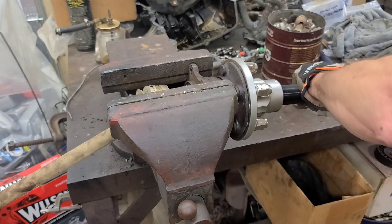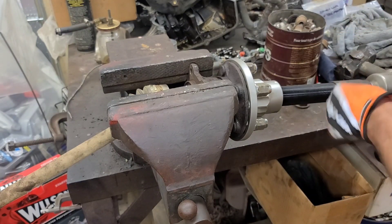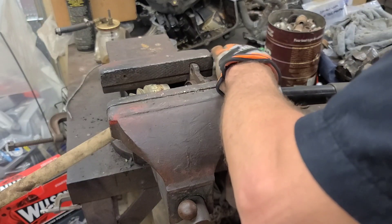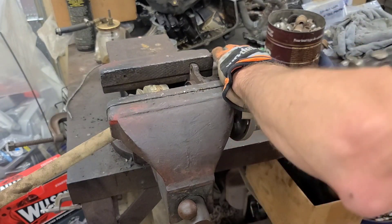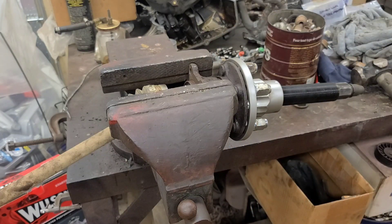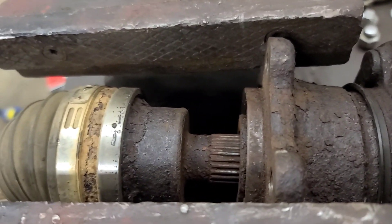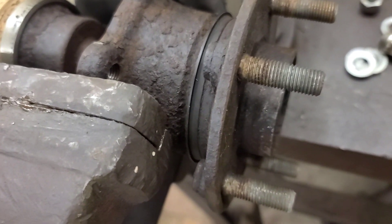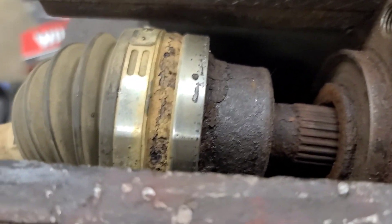Got about a quarter inch now. That made a big difference. Now at some point I'm going to bottom out this driver in the hub — I'm hoping I'll be able to tell when that happens. I'm going to take the screw out and have a look, because maybe my tool is actually bottoming in there. I've got the axle shaft out — almost a half an inch. I pushed it as far as I could until it felt like it had stopped; the end of the axle and the driver bottomed out so it won't go any further than that. It's still seized in there, but it's actually moving now, so I should be able to get it out the rest of the way.